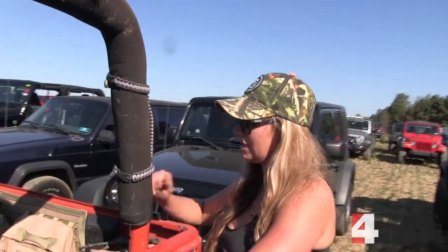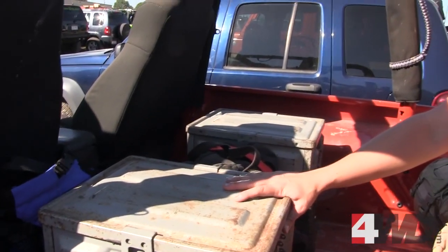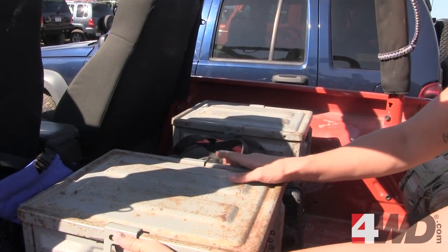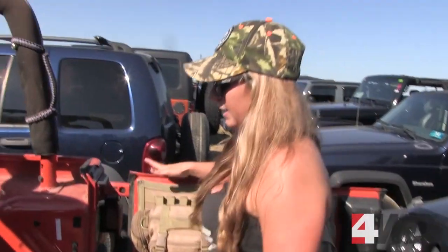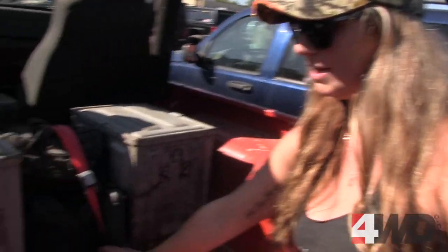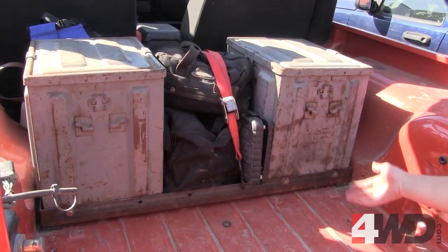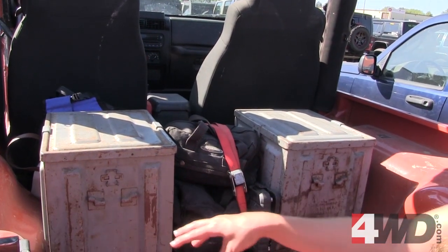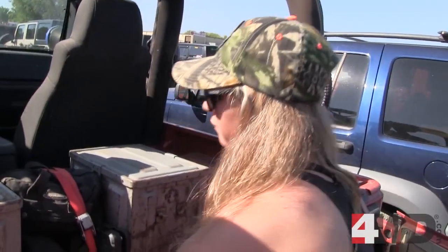This is actually one of my favorite additions that I made to the Jeep. These are just big ammo cans where the latches come out. This was my first big welding project — I created this frame just with 90-degree iron, created the box, took the back seat out, and just used the same bolt holes from the seat brackets to put this in.